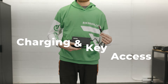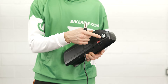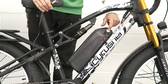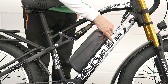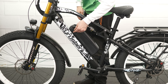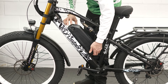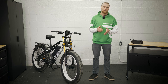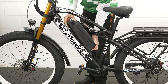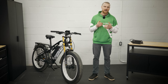The battery for this bike is externally mounted and recharges using a 54.6-volt, 2-amp output charger. It's going to take you over 8 hours to fully recharge the battery. The charger plugs into the same slot on the side of the battery when it's charging, whether mounted to the bike or off the bike, and the charge slot is covered by a rotating cover. The battery can also be removed by inserting the key into the hole on the battery pack side — turning the key unlocks the battery, which can then be removed with a good tug upwards. Sometimes the battery could get a little stuck and require a little bit of force. Reinserting it is just the reverse — make sure to line up the plastic rails with the areas on the rear of the battery before reinserting it. After it's back on the bike, you can lock it onto the frame with the same key, or it slides and locks in place.